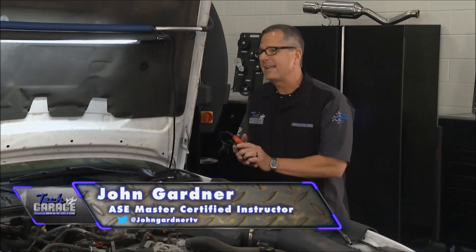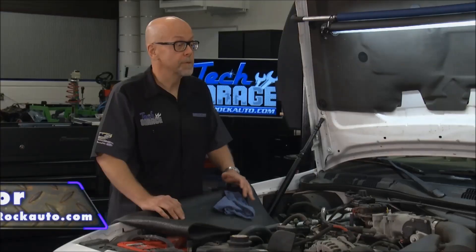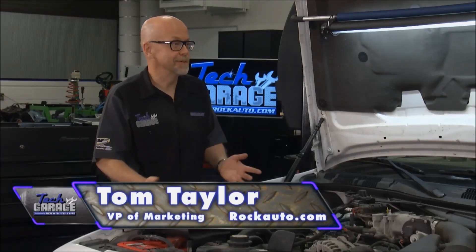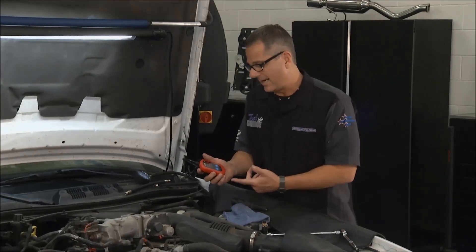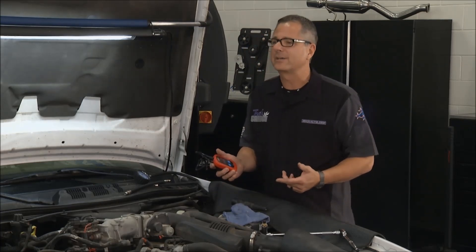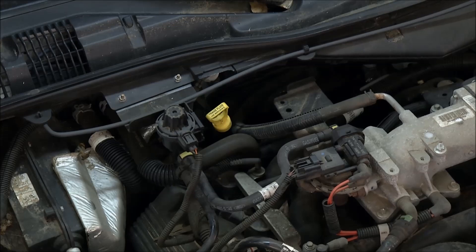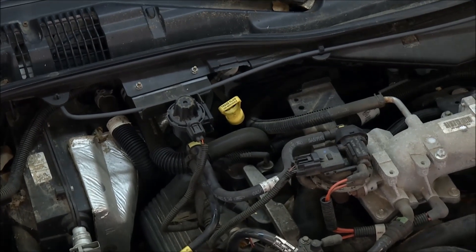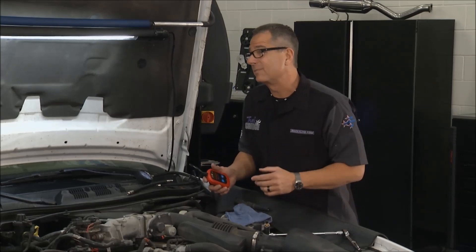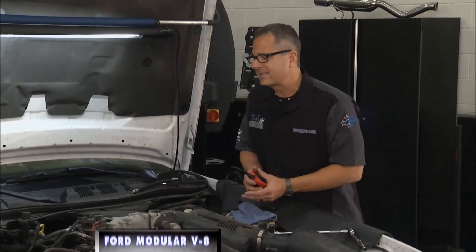I went ahead and scanned for those codes with the scan tool. We have specialty tools that make jobs easier and more fun, like the scan tool, and we'll use them throughout. When I scanned it, I ended up with a P0300 — that was a misfire, pretty indicative of how that engine was running. I also had a P0442. You mentioned that gas cap? It could be — it's an emissions problem. We'll have to dive into that a bit later. But where better to start than the engine and its diagnostics?